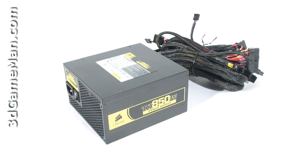Fourth, I'd recommend choosing a power supply that has APFC. APFC, or active power factor correction, is something that also assists the power supply in being more efficient and therefore stable under load. APFC basically reduces total harmonics, corrects input voltage, and it allows for full input voltage range. Thankfully, this power supply has APFC.